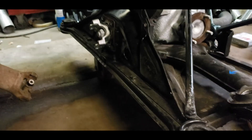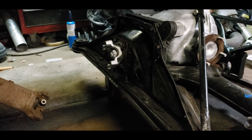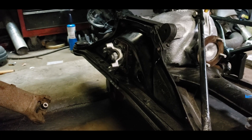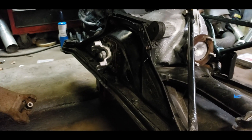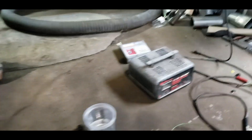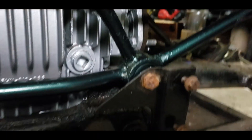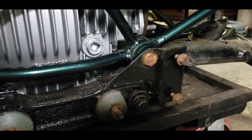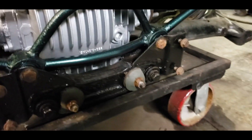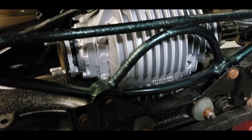What I ended up doing was cutting open a part of the front frame, bending it back, putting the yoke through the hole, then swedging it back into place and welding it up. That's good to go. Tomorrow I'll be dropping it into the car and putting the half shafts and all that stuff back in. The sway bar modification I had to do turned out okay — everything lines up and the sway bar lines up like it's supposed to. I just painted it, it's drying right now. Tomorrow we'll see how she fits and then I'll start on the driveshaft.